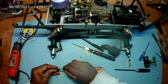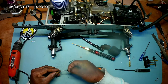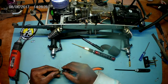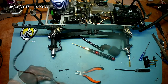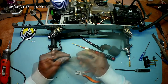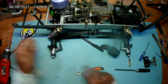So you can see me taking it back off and measuring, gauging how much I'll have to cut the spring down so it's a perfect fit for the carburetor. Because the carburetor is a sliding carburetor, when the servo operates, it pulls the carburetor towards the edge of the Mad Force wall, and therefore that little rod sticks out the other side of it. Not only that, if you've got a body that's quite close to the side of the Mad Force, it will actually stick into the body.